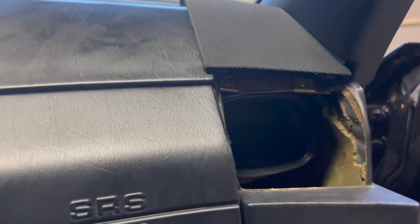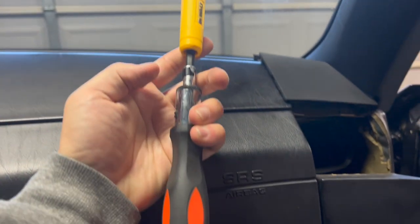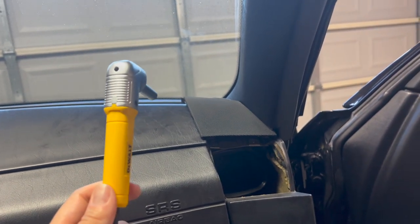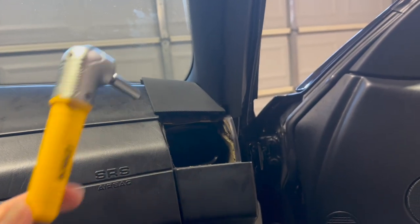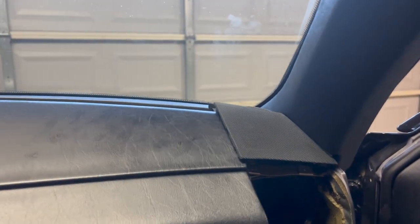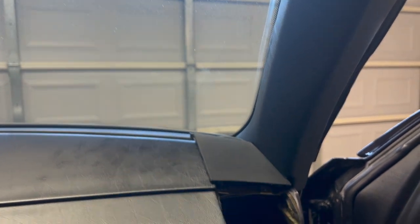So what's my tip for you? I bought from DeWalt a 45-degree angle bit and attached it to just a ratchet screwdriver - I didn't want to use a power screwdriver because that would be a little extreme, but that is what worked and that's what I was able to use to get this out. Because if you're trying to use a traditional screwdriver there's just no leverage, and your standard little precision screwdriver - this isn't a Phillips head but pretend it was - you don't have enough leverage to get that out. So if you don't have a 45-degree angle screwdriver, pick one up.